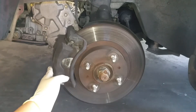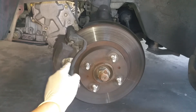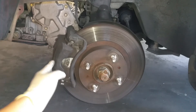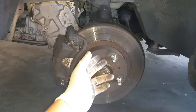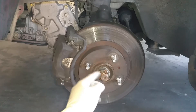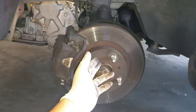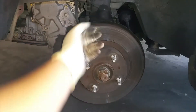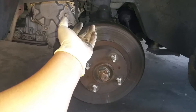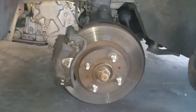What we have here is the brake caliper, and inside of it we have our brake pads. If you are replacing just your brake pads, all you need to do is loosen up two fasteners in the back of the brake caliper. If you want to replace your rotors as well, you can tell if they're bad if you're braking hard and feel your front end shake side to side — that's a good indication they're warped. You can also drag your fingernail up the edge; if it catches, the rotor is likely warped. In my case, my rotors are not in bad condition so I'm not replacing them.